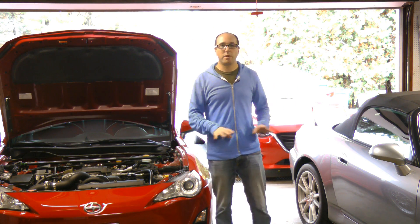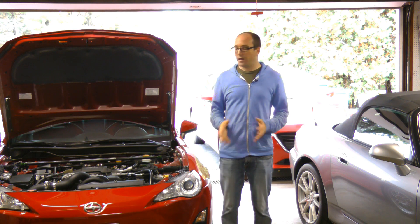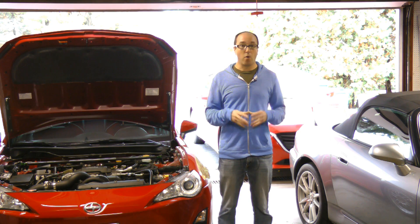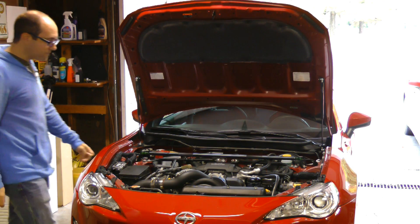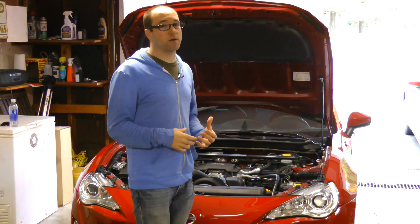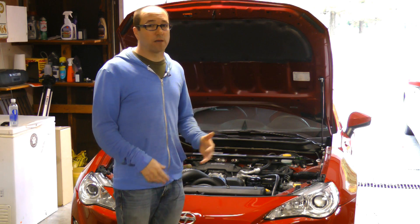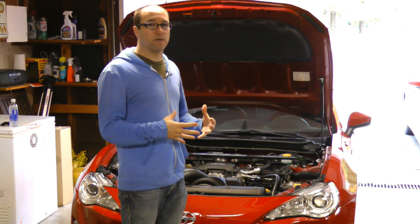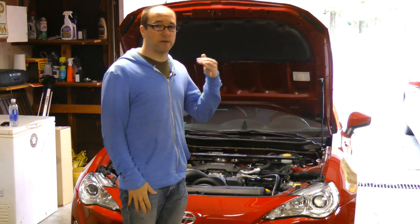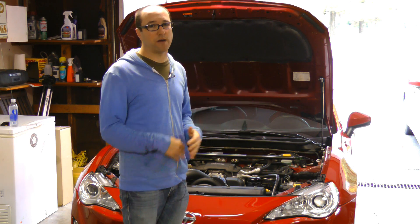0w20 is what the car is spec'd for — perfectly efficient. If you're naturally aspirated on the street or doing autocross, you can run 0w20 all day long. The limits of 0w20 are around 225 to 235 degrees oil temperature. 10w30 is a pretty good balance, but if you're on the track more, in a warmer climate, and really going flat out, 10w30 is going to thin out very quickly. A 10w40 is pretty much the best balance between street and track for a supercharged or naturally aspirated car — it allows you to maintain good oil pressure up to about 265 degrees Fahrenheit. At 265 degrees, you'll start seeing the low 40 PSI range at 7,000 RPMs.